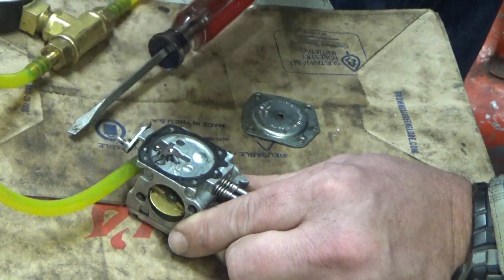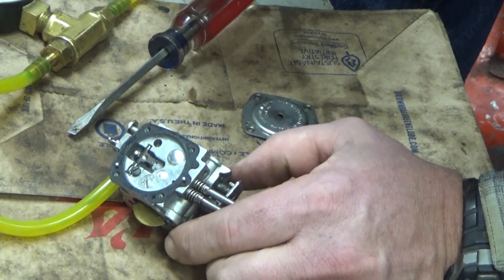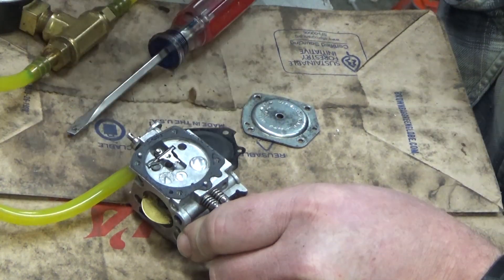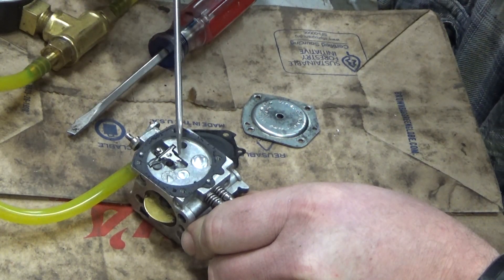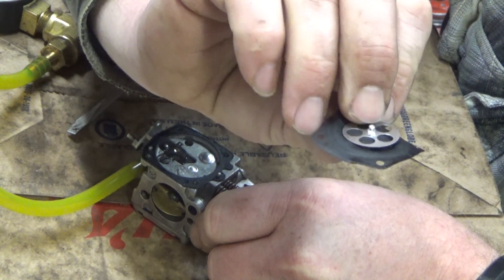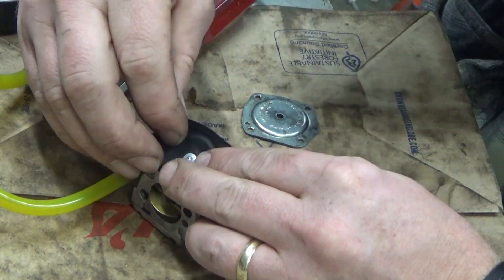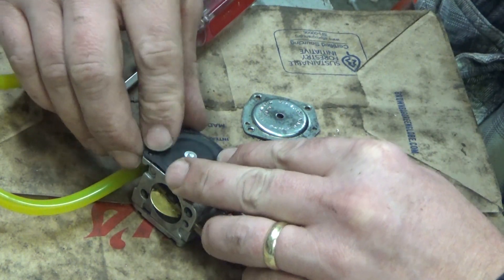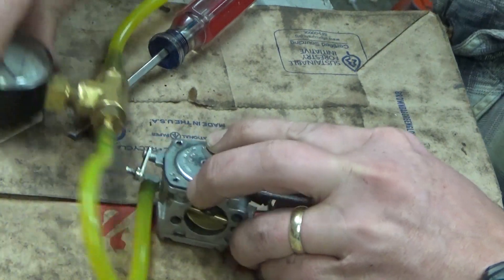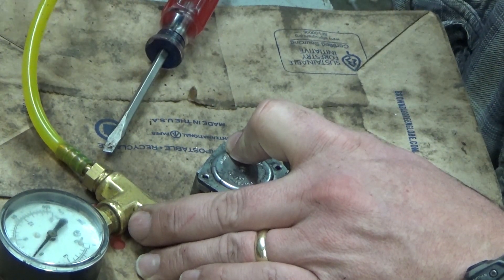I know this has had a kit put in it. We'll go through the entire thing. It didn't feel like this was indexed into the inlet arm — you guys see how there's kind of a fork right there, and the little nipple on the back is kind of grooved to allow you to slip that in. It came off awful easy, and the inlet needle arm seems a little high. I know I indexed it that time — nope, she's still leaking past.